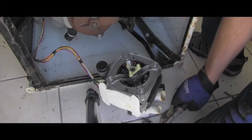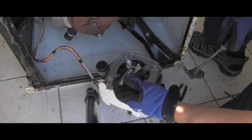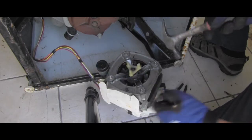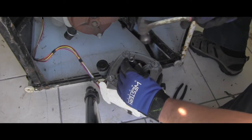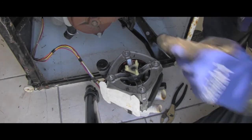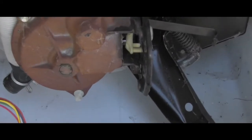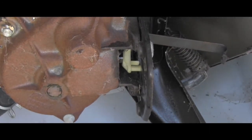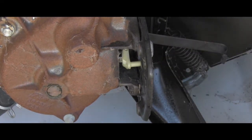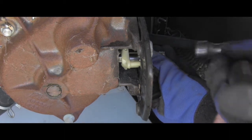I discovered that the steel inserts in the new model are kind of tight, so I'm using a socket which is the size of that steel area and nicely, carefully tapping it onto the shaft. It's perfectly fitting. I'll do exactly the same on the transmission shaft — making sure I'm touching just the steel part — and tapping it nicely onto the shaft.